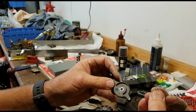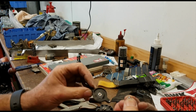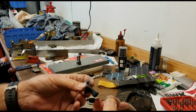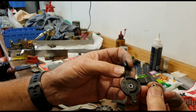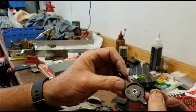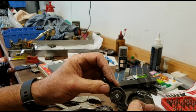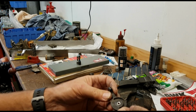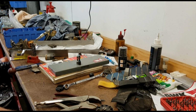So that would be the reason why the cam was no longer connected to the handle, and it was the reason why the belts would not release. Why would that happen? I think this probably would be a mechanism that would be entirely reliable under most circumstances. Possibly the material choice of die-cast, maybe a stronger material, but it was adequate under normal circumstances.